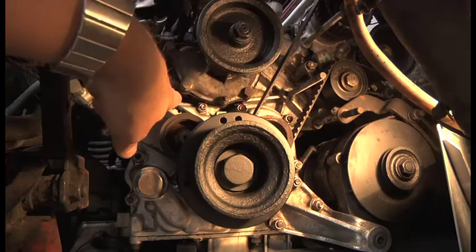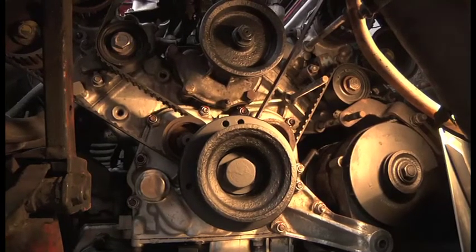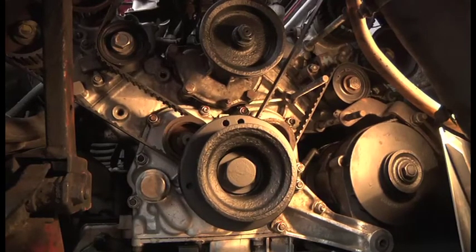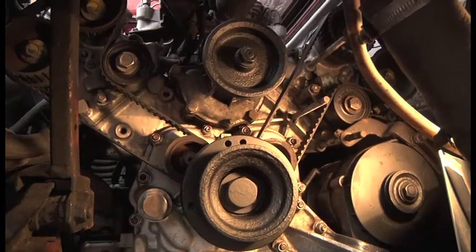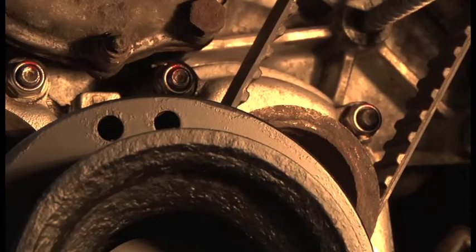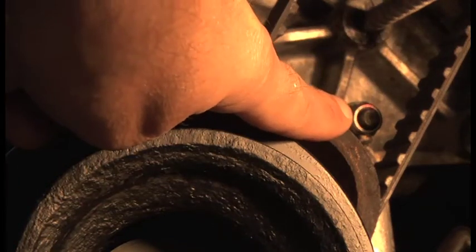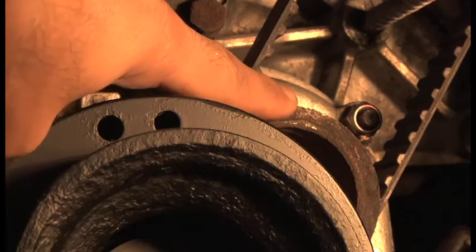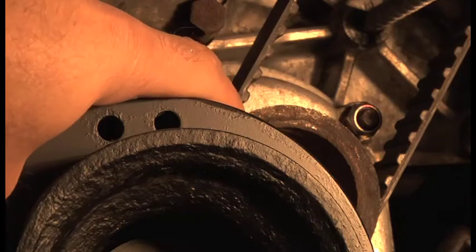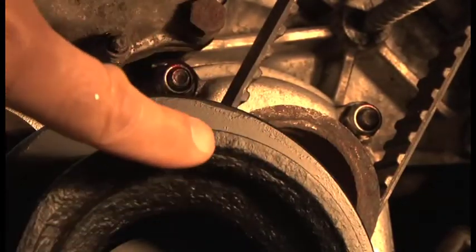The belts had a lot of oil on them, which is why I'm changing them out anyway, even though it's 3 years, but as most of you say, probably go to five if it's not done many miles. They were impregnated with oil, so I decided to get them changed out. Something I've done is change out all these nuts for stainless steel ones, because they were all really corroded. You can see what looks like corrosion on here. It's not that bad, it's fine. It's surface again, nothing that a wire brush wouldn't sort out, but I'll do all that when I come to do the cam belts. This looked far worse, but you can still see some surface stuff.